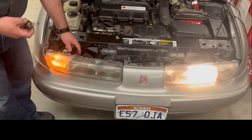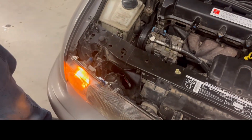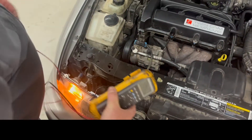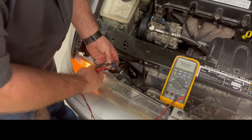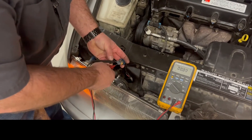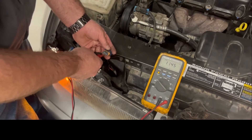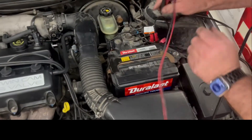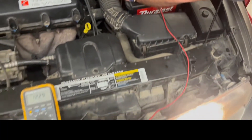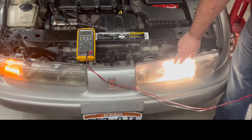But we're still not getting light. What most people will then do is see if they have volts to the light bulb. Whenever we disconnect something, we're going to see if there is voltage present at that connector. We have voltage here, but the light bulb still isn't lighting up - 11.45 volts is what we're seeing. Verifying voltage from the battery power supply source, we have 12.2 volts, which is more than the voltage at the connector.